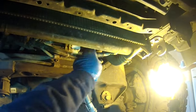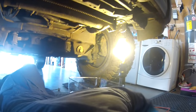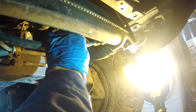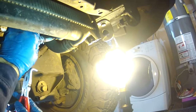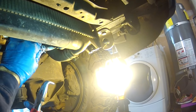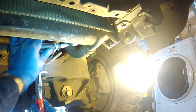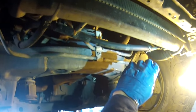Now that we're done, I'm compressing the clamp again and twisting the drain tube off. I'm going to put the original line back on that returns to the transmission - slide that on, wipe it off a little bit. Grab my bent 90-degree needle-nose pliers, compress the clamp, get it back where it was sitting before. You can see the indentation where the clamp was sitting before. You don't want the clamp resting on the nipple part of the fitting - you want it compressing on the round part, so go a little more inboard. The return line is now securely back on.